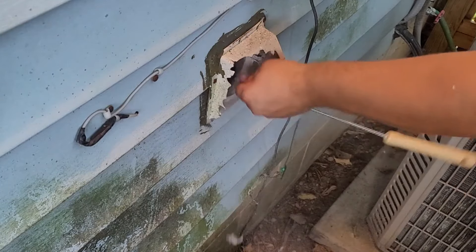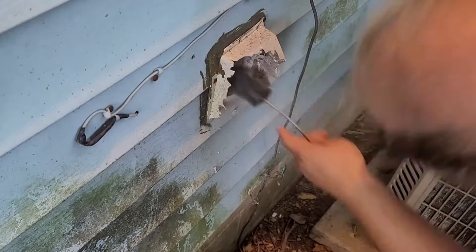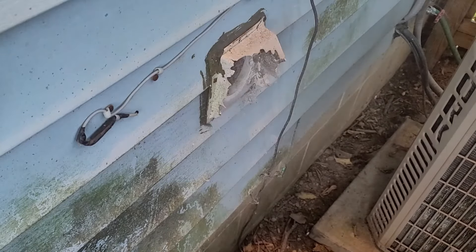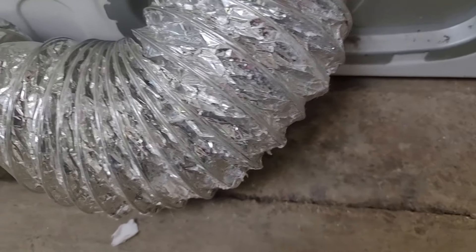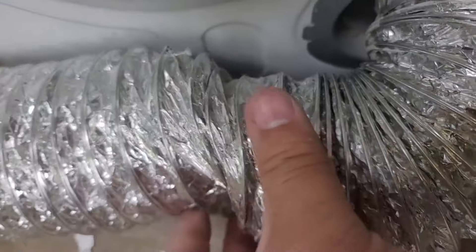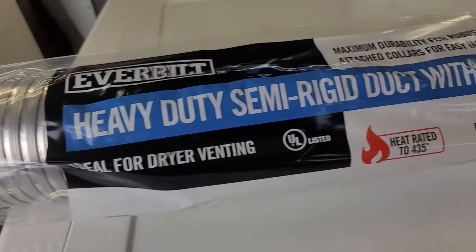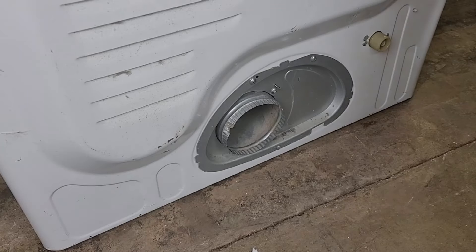Critters and other things could get inside the vent tube and cause all sorts of problems. There's also an incredible amount of dust in the tube. You can use a condenser brush to remove some of the dirt, but really you want to use a full-fledged dryer vent cleaning kit — it's the better choice. This cheap device could save you hundreds of dollars in repair fees. If you have a flexible vent, remove any kinks or crushed areas, but the best bet is to replace the flexible vent entirely and go with a semi or fully rigid vent hose — far more reliable.